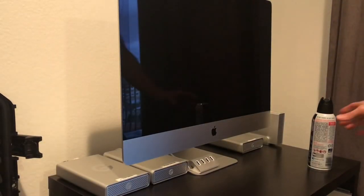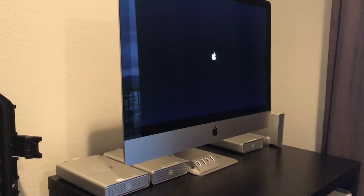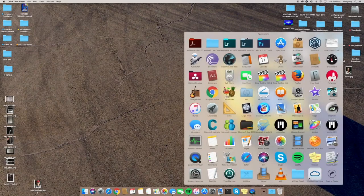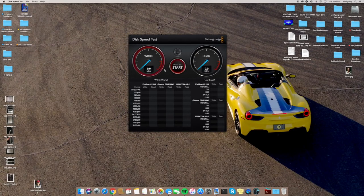And just like that we are finished! Let's see how everything boots up — and there it is, everything loads. Now for the moment you've all been waiting for: let's check our speeds using BlackMagic Disk Speed Test. Write speed: 427–428.9 MB/s. Read speed: 479–483.5 MB/s. As you can see, the computer is about four to five times faster with a solid-state hard drive, which makes it a lot snappier, more responsive, and definitely boots up a lot faster.